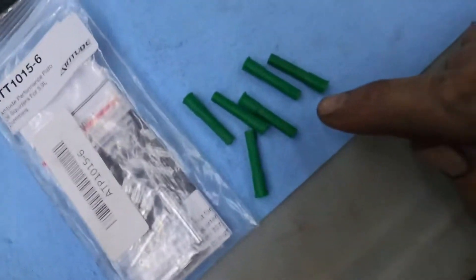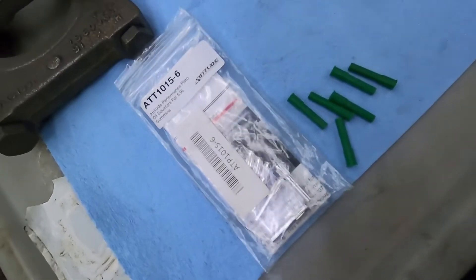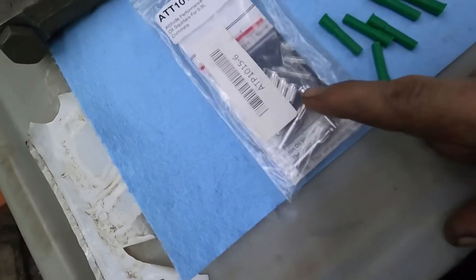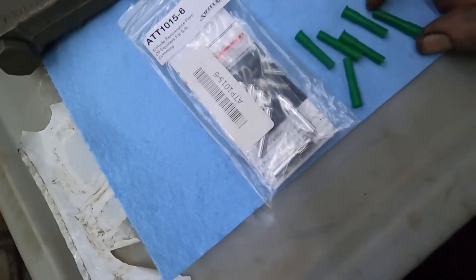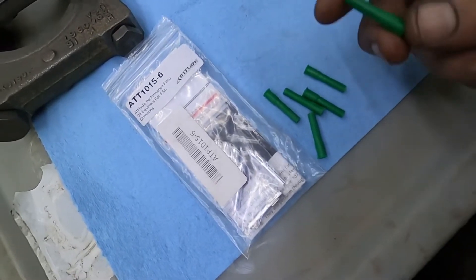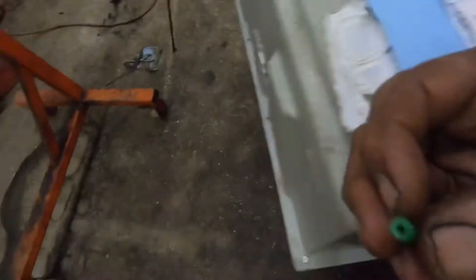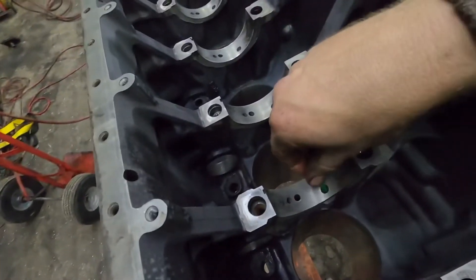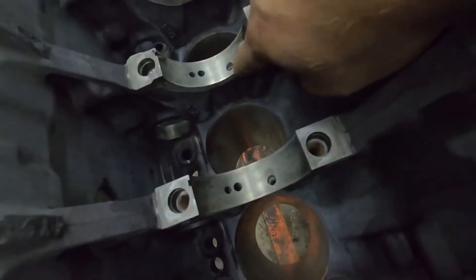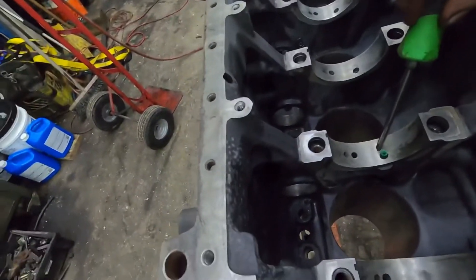There are shorter ones — they're about this length and they're usually clear. Don't use those ones for this application; you want to use this style. Now this engine isn't going to be anything special as far as horsepower goes — it's going to be about 300–350 horsepower at the wheels, so you could use these if you want for extra insurance. These don't usually have an issue as long as you're using good oil filters and you don't whack it with something when putting it together. You do see the odd one of these fail, but not very many — they're made of pretty good plastic. They go into the block on each cylinder, basically the oil squirters that squirt oil in there, one per journal.